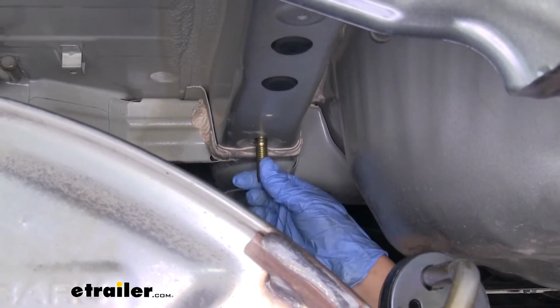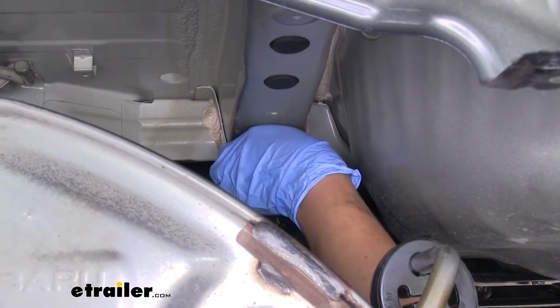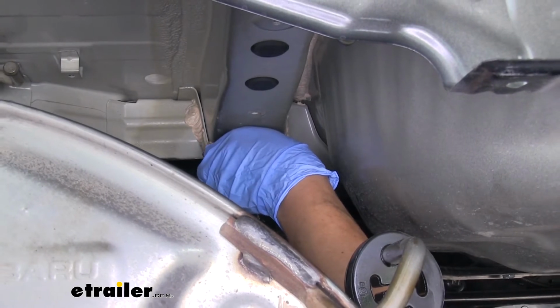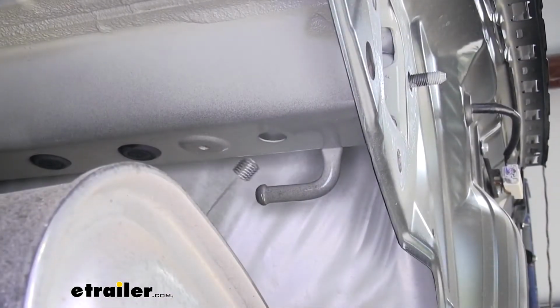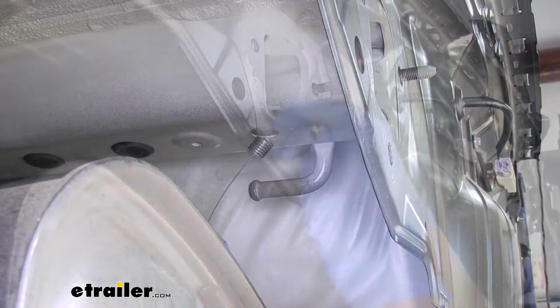We're going to very carefully remove the pull wire from the bolt because we are going to have to reuse it. So we'll just uncoil it. Don't want to pull on it because it will damage the coil and it won't thread on anymore. And then we're going to repeat that whole process with all 3 remaining holes that we unplugged.